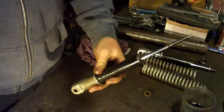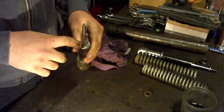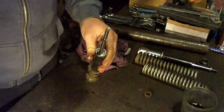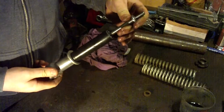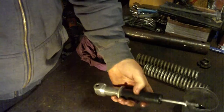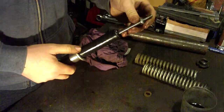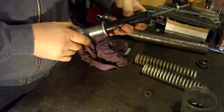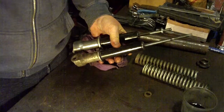So this is it. This is how you can replace oil and clean this part, and if necessary you can replace this part, or if you can find rubber rings that go inside, you can also do that. Now the same thing is with the Max shock absorber. Inside there are few differences, but everything is the same as in this one. I don't know, are there differences in the looks or standard Max. So this is for Super Max, Special Max and Maxi. They have this type of the front shock absorber.